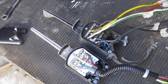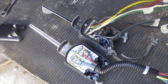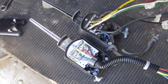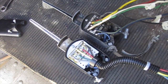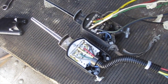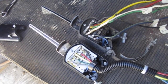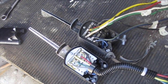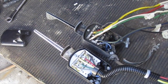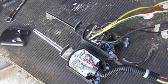I'm tearing into the turn signals on 12 and I'm installing a new Signal Stat 900. The one that's in the truck appears to be the original and it was not working. In ordering a new one I noticed my new one had an extra wire and some of the wires were different colors. I opened it up just to trace the wires and I think I've got it figured out. The red and black wires on both of them are for the right-hand lights — the right front is red and the right rear is black. The green wire on both is the left front; however, on the old one the left rear is a white wire, but on the new one it's a gray wire.